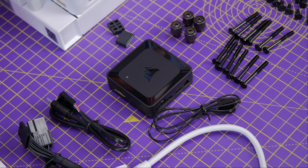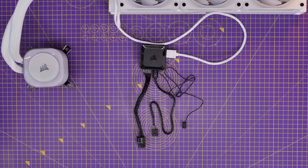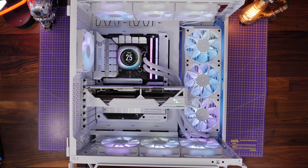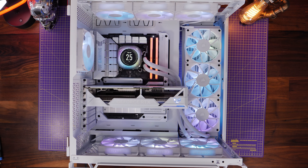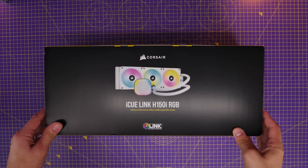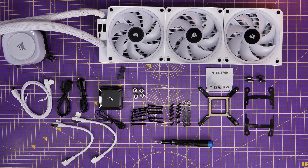This little control box can control up to 24 devices — that's 12 per port, with one port on either side. You get the controller either with a cooler or with a triple pack of fans, and there are some complexities to the wiring that are worth knowing. I'm going to cover what those are so you can end up with a really clean system with individually controllable fans, all from iCue software.